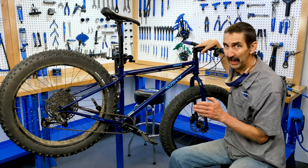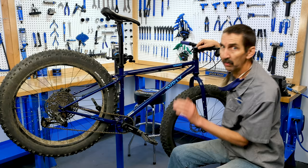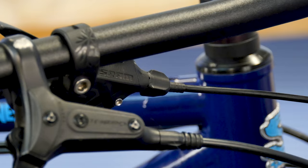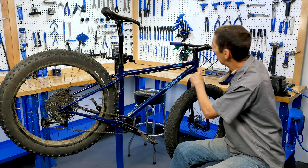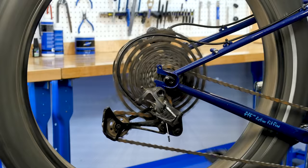What's going on here? Good shifting? It's actually pretty good shifting for a lot of them — two bad ones. 12-speed here, but let's talk about what to do. You're on the saddle, you're riding along, and things are skipping. What can we do? You don't want to stop. There's an old adage: when in doubt, turn it out. Turn out the barrel adjuster a quarter or a half turn. It's the tendency for our cable systems to slacken, so if it's an index problem, let's give it a try.